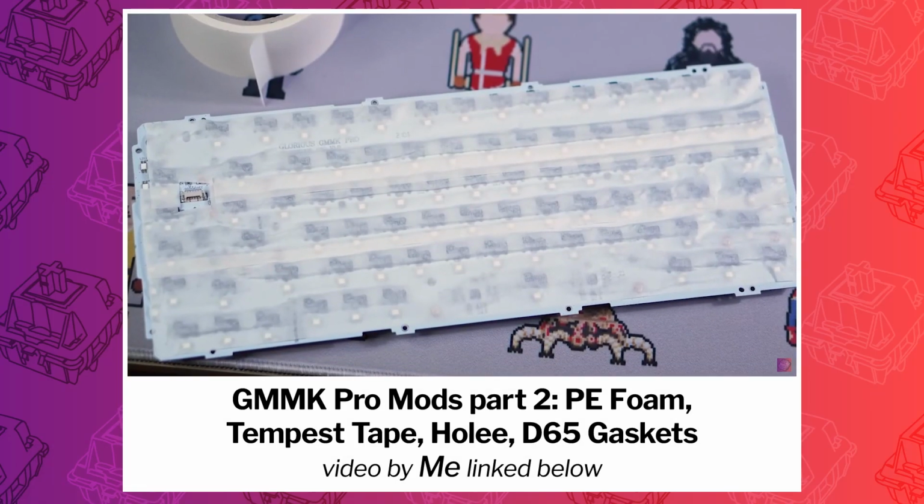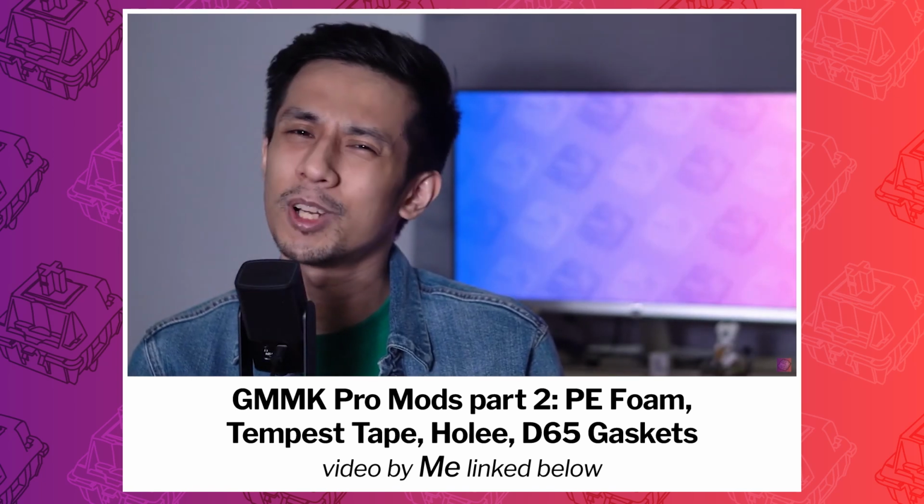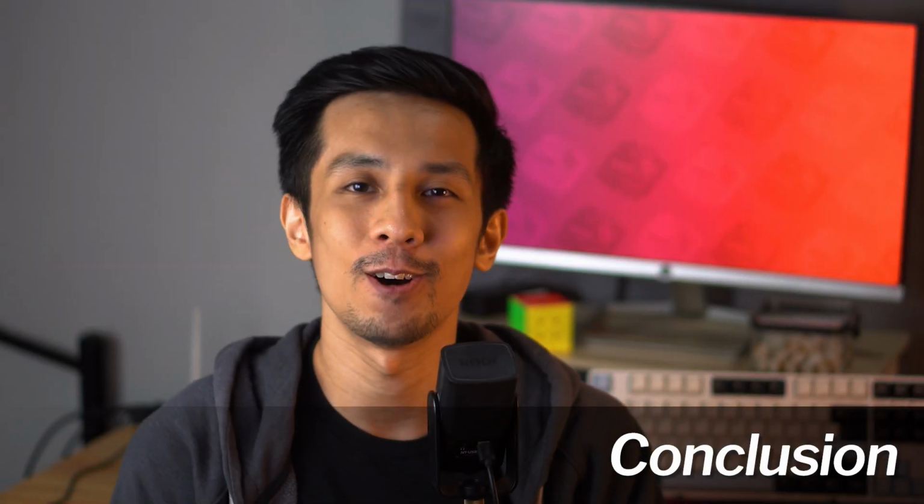I did already previously try the tape mod on this board, but it did not sound this good. The tape and the silicone seem to be working harmoniously here to bring what I can only describe as the thok. In my GMMK Pro Mods 2 video, I said I preferred PE foam with no tape, but lately I've been preferring the opposite. I tried PE foam here and in my previous video with the LK67, but I liked both better with just tape. Overall, I'm very happy with how this turned out.